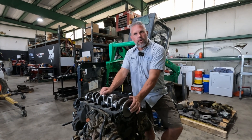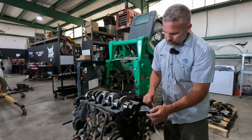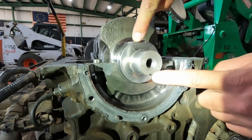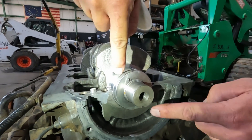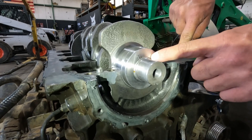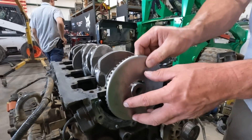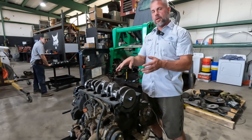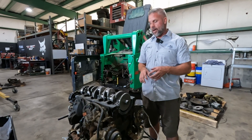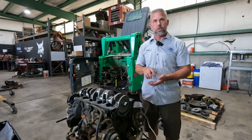I called my buddy and asked if he still had the old crankshaft. He sent me pictures of the end of the crankshaft — and sure as hell, comparing the crankshaft keyway: on the new crankshaft the pin is just to the left of the keyway, about 20 degrees. On the old crankshaft, the pin is on the right side, 20 degrees the other way. Somebody at the factory who manufactured this crankshaft drilled that pin in the wrong position. So our injection timing was out of time — the piston could be on the downstroke or the exhaust stroke, and it was just firing fuel at the wrong time.